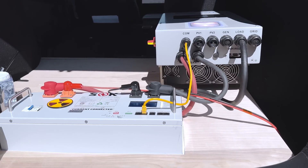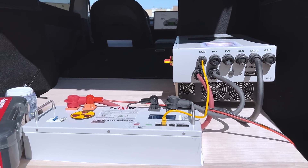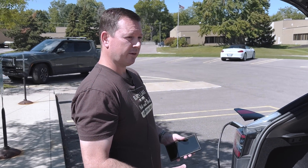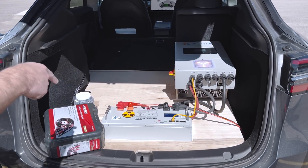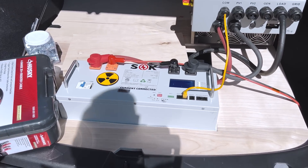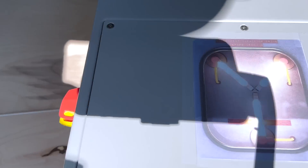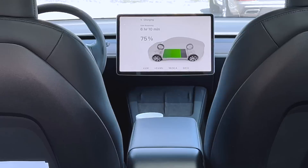Which reminds me of another thing — cooling. Part of the reason to leave a little later in the year is the temperatures are cooler. The great thing about the Tesla is you have cabin overheat protection, which is kind of passive — with or without AC. If that's not enough, I could put it in camp mode, but I'm not sure I'll need that. This inverter is pretty efficient and tends to run pretty cool. I did a test — it's about 10% losses. At 5,000 watts, that's only 500 watts of heat, equivalent to about four passengers sitting in a vehicle.